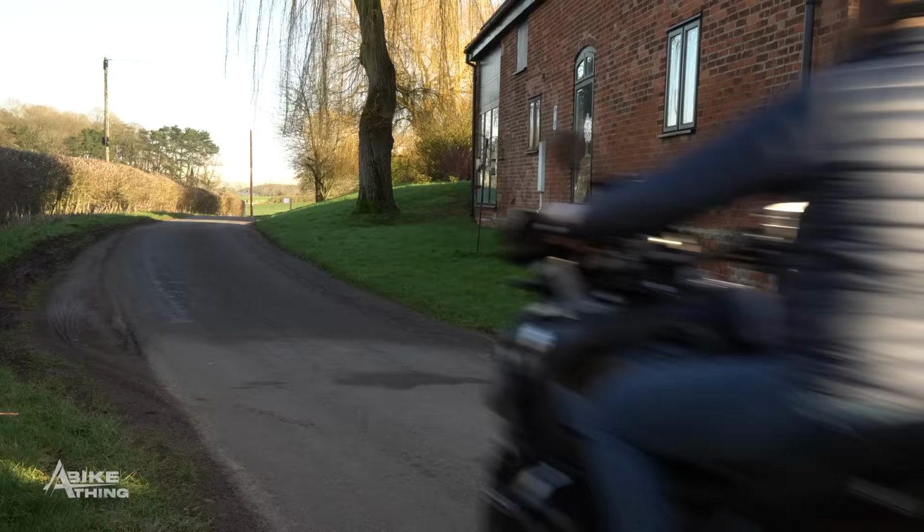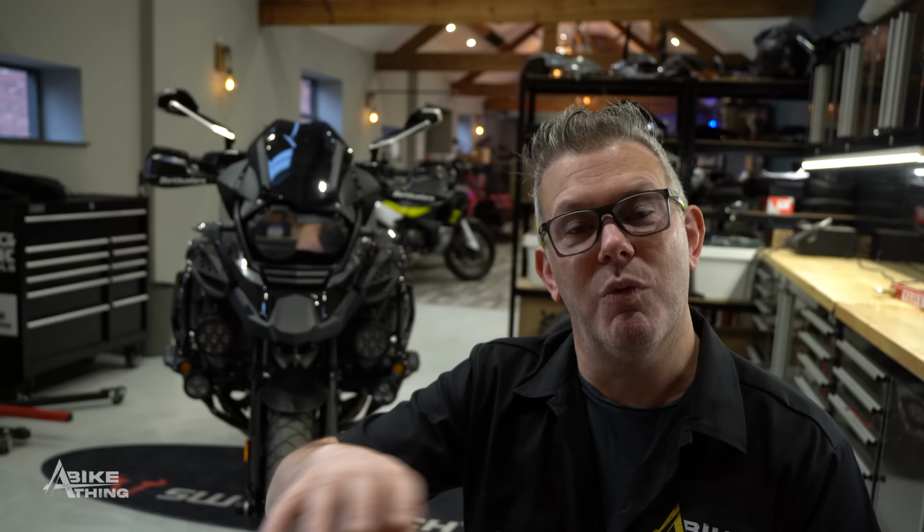It's not like me to do upselling, but if you've got an ezcan on your bike with a rear B6 light, well, then you can program that rear B6 light to be a run light, can't you? Which obviously gets brighter when you brake as well. But when you have it in position one on the visor lights, we can have the B6 on all the time as a run light at, let's say, 20% brightness, which gives you that extra visibility.